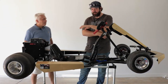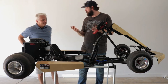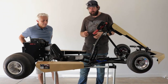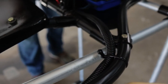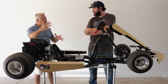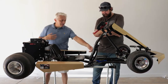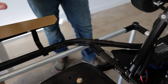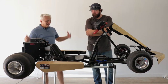I love the non-traditional uses of the connectors. People ask a lot about the strength, and the way you've modified them — drilling and running a bolt through the connector and conduit — has given you extra rigidity. My first build I made no modifications to the clamps, but as I tested the go-kart and felt the g-forces, I saw some areas that needed improvement. So at key stress points I drilled and added an extra screw to hold the frame together so it won't move anywhere.